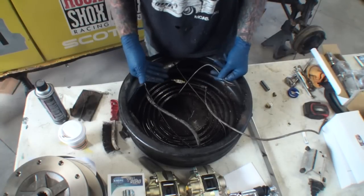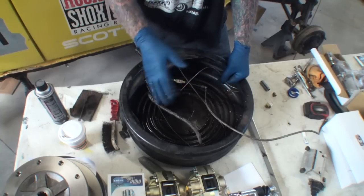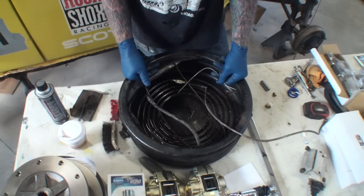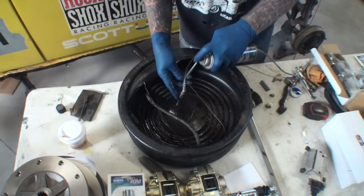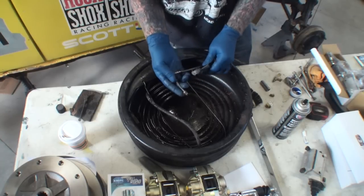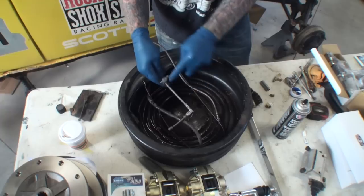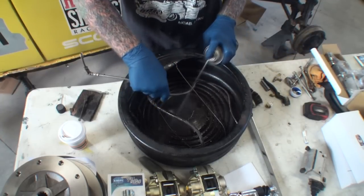When I took these brake lines off, they weren't mounted or secured to anything — they were just kind of in there slopping around and bouncing, which was very unusual on an off-road car. So when we put all this back together, we will make sure that everything is secured tightly to the body of the car and not bouncing around and possibly breaking one of our brake lines. I'm thinking about making a new brake line fitting or just ordering a number three.